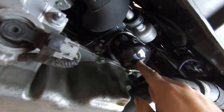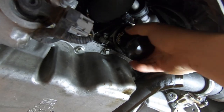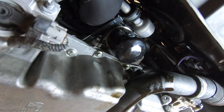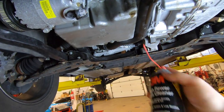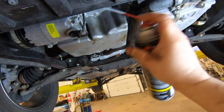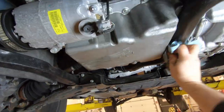At that point, you want to go three quarters of a turn to make it tight. Find an identification mark on there and tighten it down until it's about three quarters of the way around, and that's it. One of the last steps I like to do is take some brake cleaner and spray down everywhere I was working, then come through and wipe it down. That's going to make sure that everything's nice and clean so you have no leaks or drips.